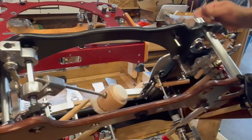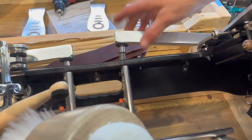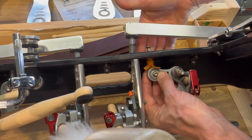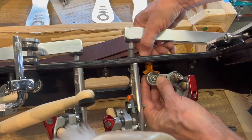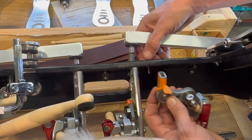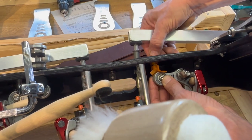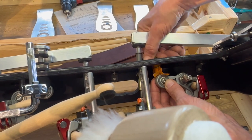So go under your drums and put that bolt in the hole. I want that sticking out just a little bit at the bottom so I can know where to put that. I'm going to push in that direction until it hits the back spine of your top board. And using hand pressure, I want you to just thread this down and make sure you find those threads. You'll know when you find those threads because it'll be kind of locked on. Not like that - I'm going to check down the line and make sure my threads are all lined up.